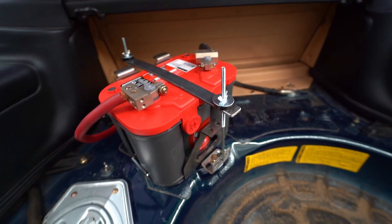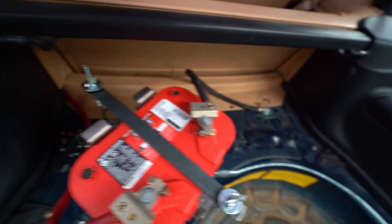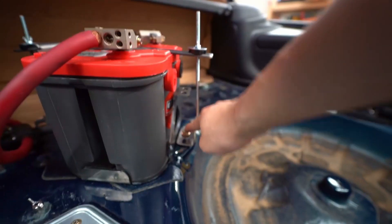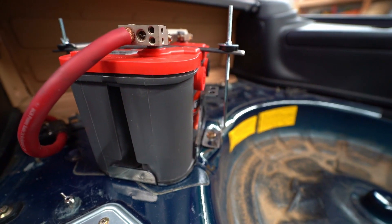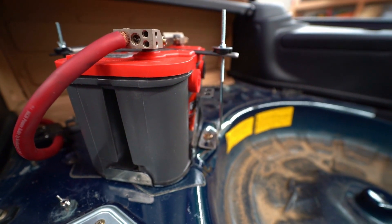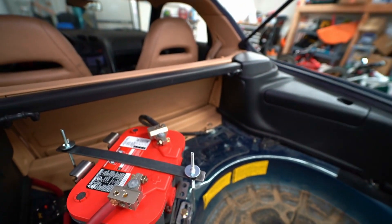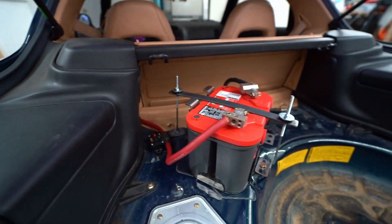All factory holes. So that's two M8 by 1.25 holes in the back, and one hole here for the 10 by 1.25 bolt. Really it's just these two that are holding the battery down — that other one I'm just using for a ground. You can ground it anywhere you'd like. But that's the overall setup right here.